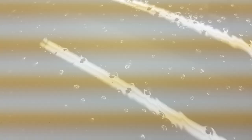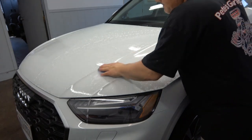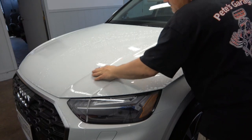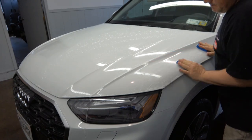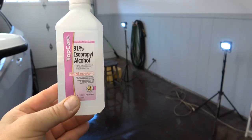Using a clay bar, rub it over the surface to remove any nubs or contaminants left on the paint. You can see the little spots where particles are holding water back — those need to go. Wet the vehicle down with lots of soap, take the clay bar and rub it across the surface — keep it moving. Do not stop because the clay bar will leave a mark. Keep it well lubricated and clay bar every square inch of the vehicle. Repeat the plastic bag test and it won't feel like sandpaper anymore.